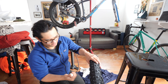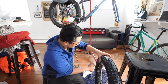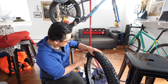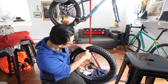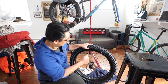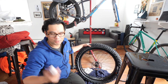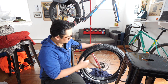Pump is charged. I'm gonna do the magic spray bottle. I know some of you are wondering why I'm not putting sealant in yet — this is called dry mounting the tire, so mounting it without the sealant. The reason I like to do this is because if you mount it with the sealant and it's just not working, it's gonna make a huge mess. So it's better to get a pretty good fit without the sealant first. The sealant might help make this happen a little bit easier, but in my experience you can put sealant in and it just won't seal and you have to remove it with the sealant in there and mop it all up. I prefer the dry mount method.